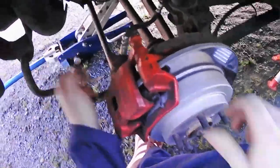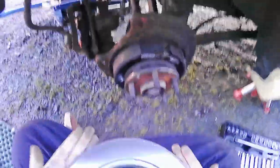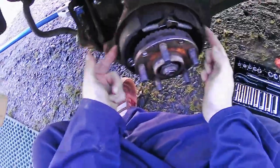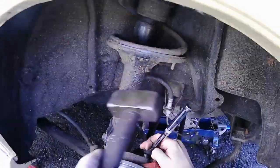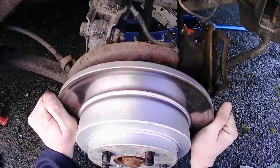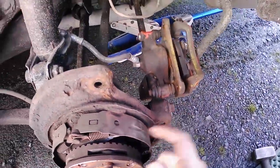There we go — and that means you don't hurt your knee. That's the proper way to do it. Now remove your caliper and start to pull off your disc. There should be a bit of resistance if it's any good. As you can see here, these are your handbrake pads — these are what we're going to be removing. Same on this side. And off comes the caliper. Now comes the disc. You can see just how easy this was to get off, because as you can see, there are no handbrake pads on this side. This is where our problem lies.